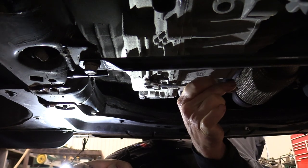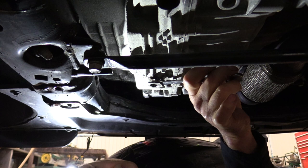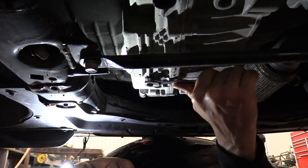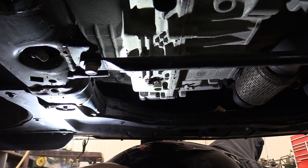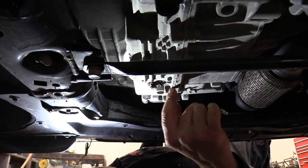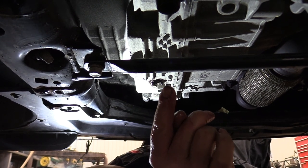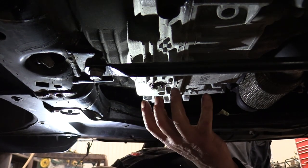Okay, so if you want to torque them, torque it to, again, about 105 inch-pounds. Okay, just take it in nice and snug, don't get crazy, and you'll be just fine. Like right there is fine. Okay, so now we're ready to fill the transmission. The other thing I'm going to do when I do this flush, I put the plug in, the check plug over there by the axle, and I do that so that the fluid don't run out as I'm putting it in, because I'm going to overfill the transmission to do the flush.